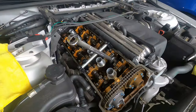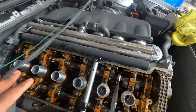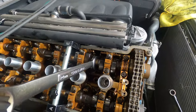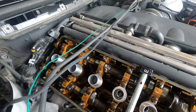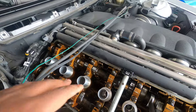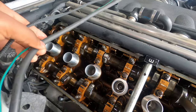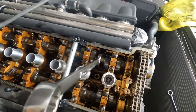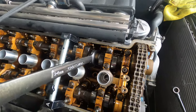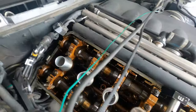Whenever you open your valve cover, you can see the top part of your engine exposed. Depending on how clean it is, it tells you about the car's history. If you see a lot of gunk and dark residue, that means a previous owner was probably not taking care of the car properly — oil changes were not done when they were supposed to. This engine is pretty much how you want it to be, meaning oil was changed at fairly decent intervals.